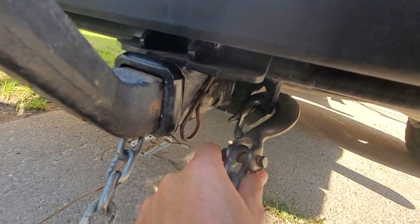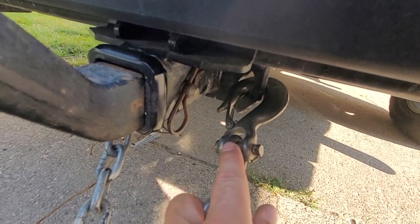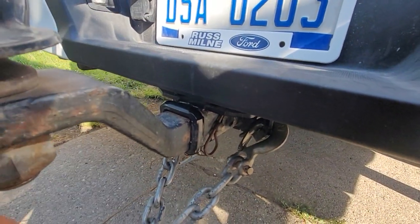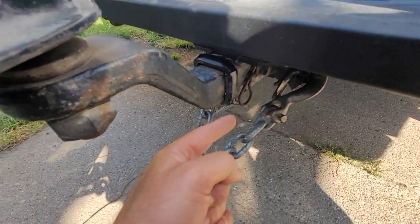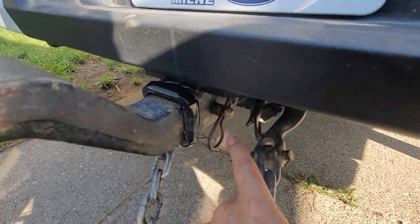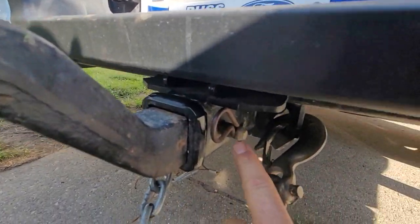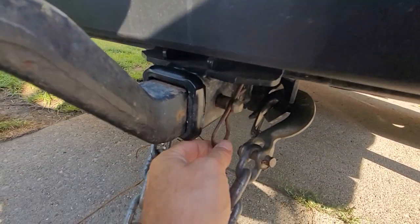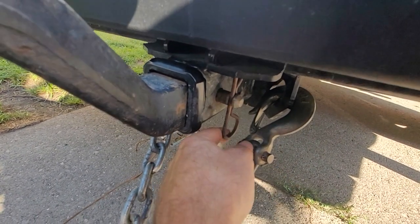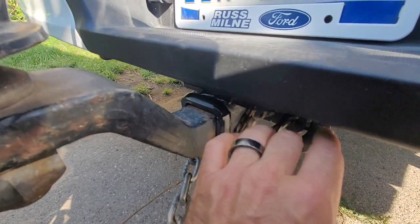See these little clasps right here with these little cotter pins — make sure in the morning that none of that stuff is broken, falling off, or rusted to the point where it's falling off. Also here on the hitch assembly and housing, make sure that pin and clip is in place as well, that it's going all the way through and clipped. Make sure that this clip pin is clipped all the way on, because if it's not all the way on, it could just pop off while you're driving. Make sure when you push it, it goes 'pop' and clips into place so it's not moving no matter what.